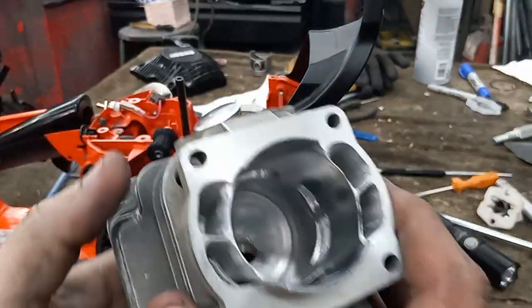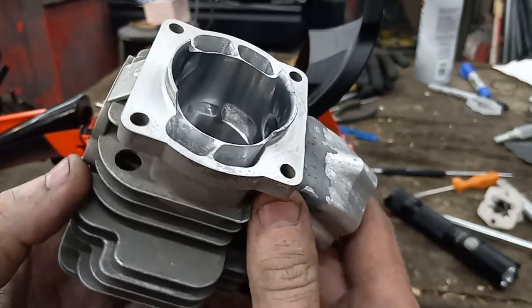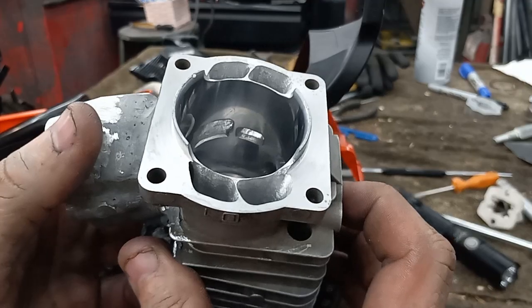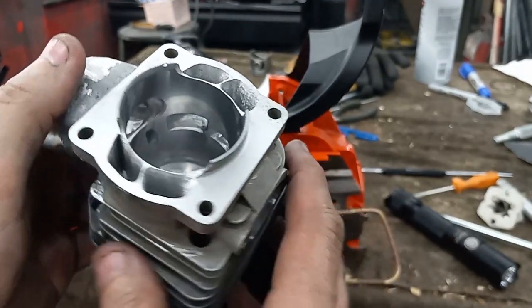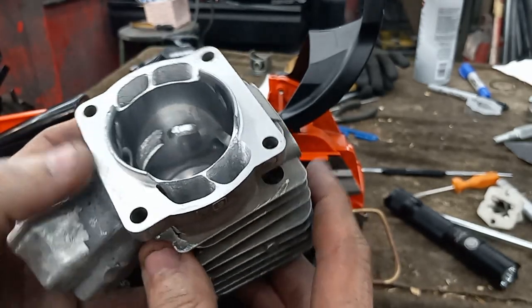The port work is done. I moved both of them quite a bit — I kind of had to, for as much as I cut off the jug. Combustion chambers cut. I'm at 27 degrees blowdown.